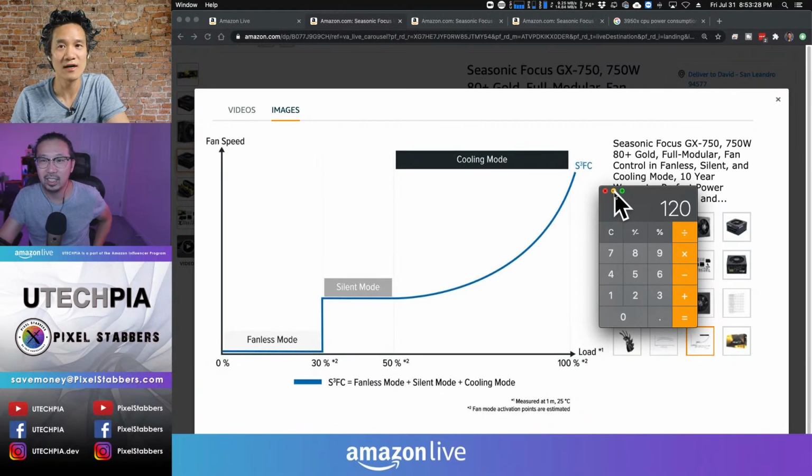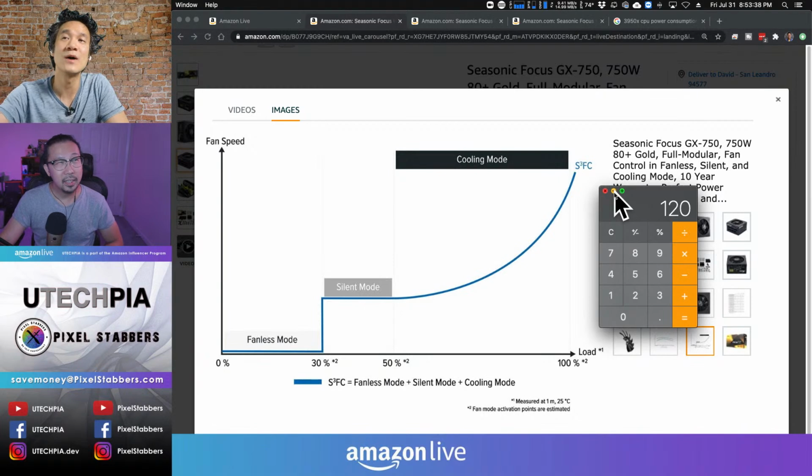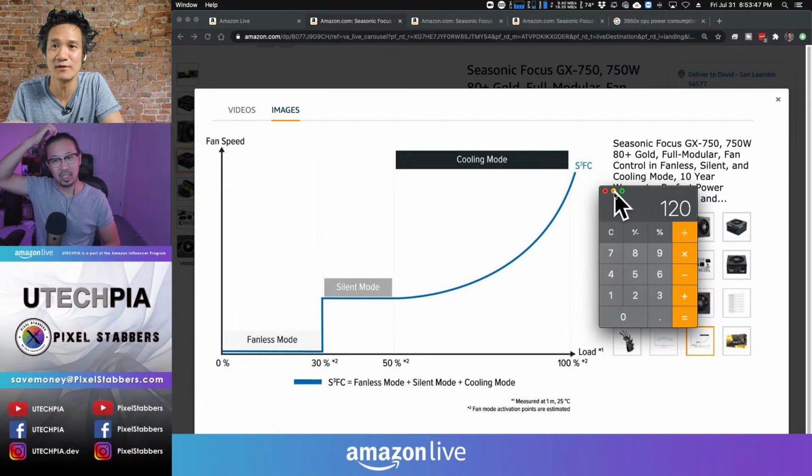Calculating. Yeah, it's not working too hard. So the majority of the usage is your graphics card. And vice versa, if you're in Photoshop, the majority of the power usage is your CPU and not your graphics card. So you always want to have an overestimation. The newest update, they kind of put the GPU to work too. Sure, it's probably 20% load or so.